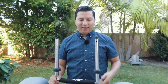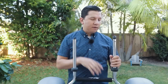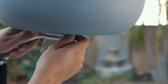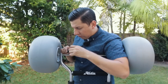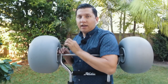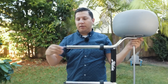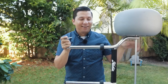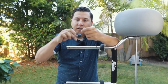I'm wearing different clothes because it's a different day — I had to go look up how to take this off without ruining it so I could maybe put it back on later down the road if I need it. First I need to take off the bottom cap. It just looks like an overhand knot so we just have to untie this and get this off the little plunger. I untied the bungee that goes all the way through here, all the way down to the top, and that should let us pull this guy out. There it is — a little sand in there. Let's keep this so we don't have to cut it and we can use it again down the road if we decide to convert this back to just a regular Trax 2-30.